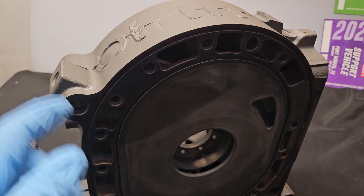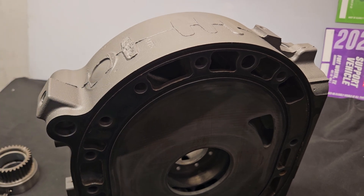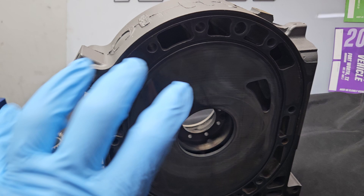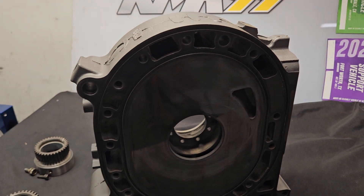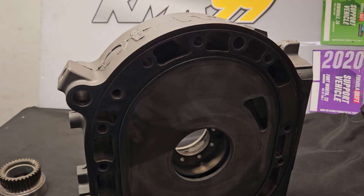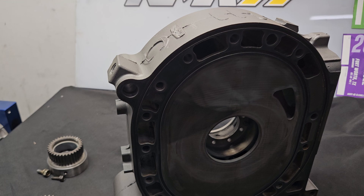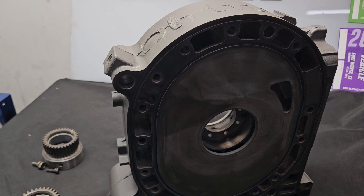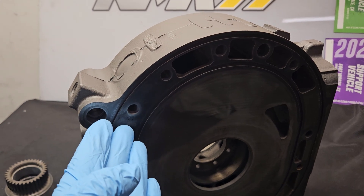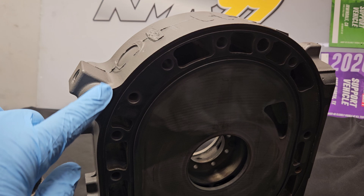If you're familiar with rotaries, it's this upper dowel area that is an oil gallery, so you're carrying oil through there that is prone to failure. It can fail due to block fatigue due to twisting — one of the reasons we stud the motors — or it can fail due to detonation or prolonged abuse and exposure to maybe not the best operating or driving conditions. Either way, it's this thin area right here that the rotor housing is pushing on by expanding under compression and boost that ends up cracking.